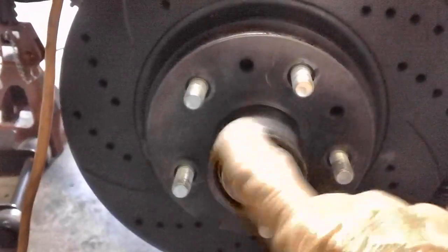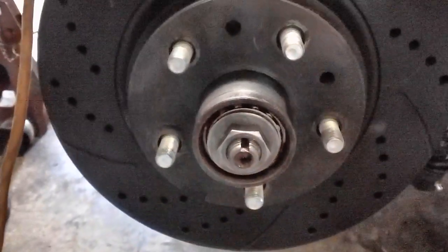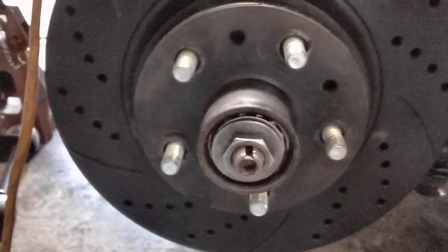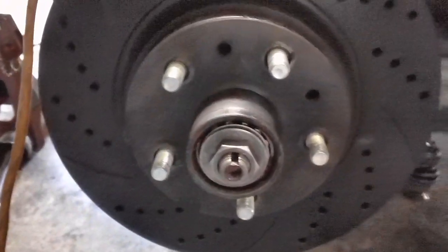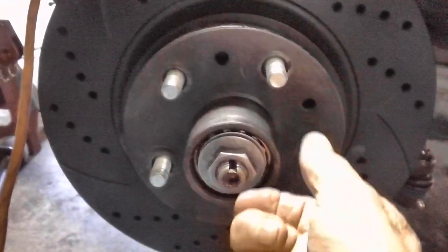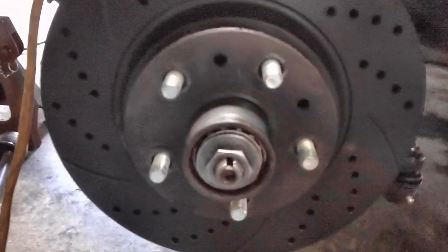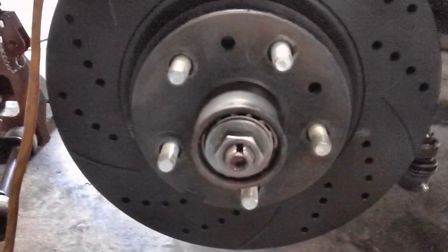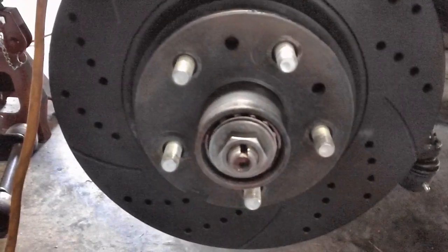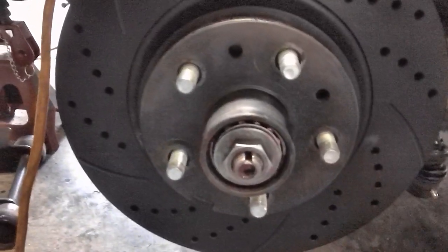Michael said, I originally torqued this thing to 22 foot-pounds — it can go up to 25 in accordance with the shop manual. And Mike said the way we used to do it was we would tighten it all the way on down until it was tight and then back it off a half a turn. He thought I should do it that way rather than torque it to the specified torque. Well, wait a minute. Yes, that's the way we used to do it years ago. And you know why?